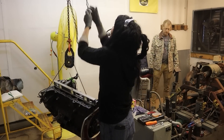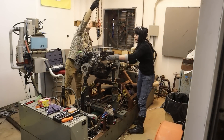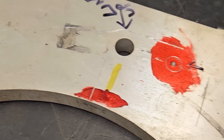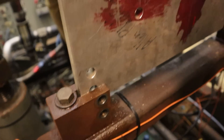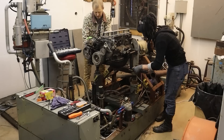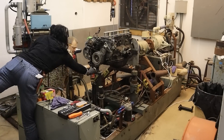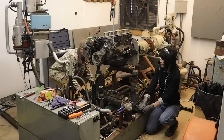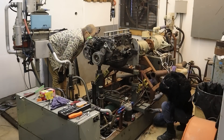You can see that we have attached this adapter plate to the back of the engine where the transmission would normally bolt up. This is going to hold the engine securely to the dyno, keep it level, and keep it from moving. This plate is a very precise fit, and we have even machined out spaces for the dowel pins — it fits extremely snug. Once we bolted the rear adapter in place, we needed to figure out the height of the motor mount jacks. I did scribe the former placement of the jacks for the small block Chevy into the tracks, then slid the motor mount jacks back towards the rear to line them up with my 7M engine mounts.